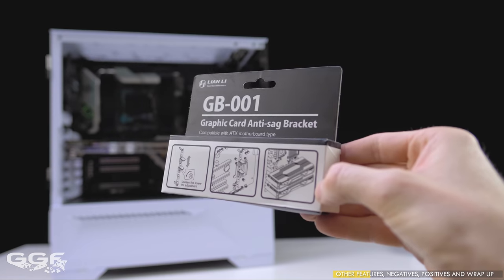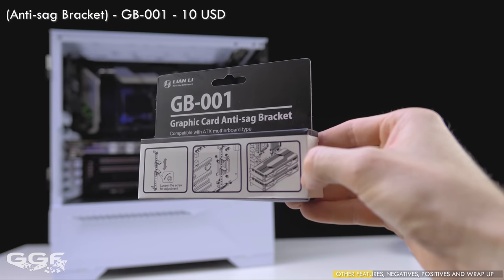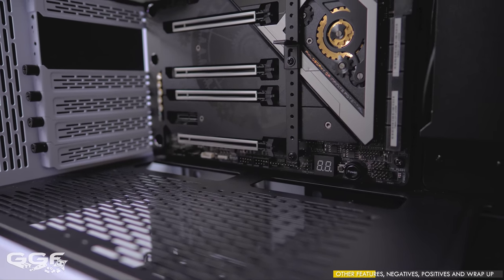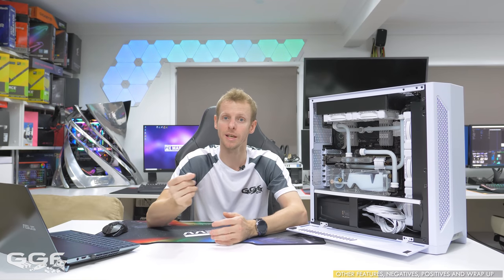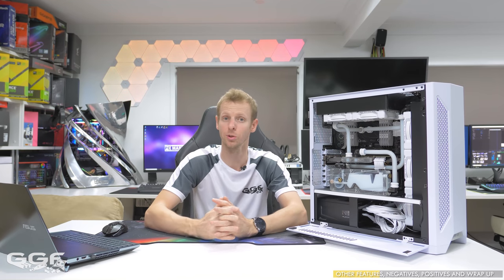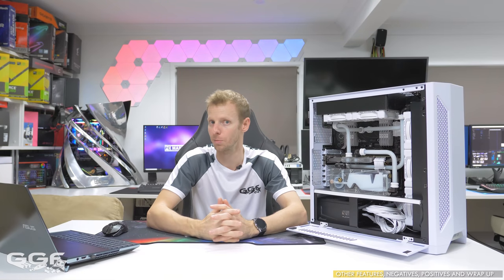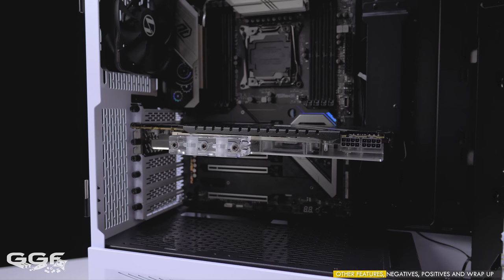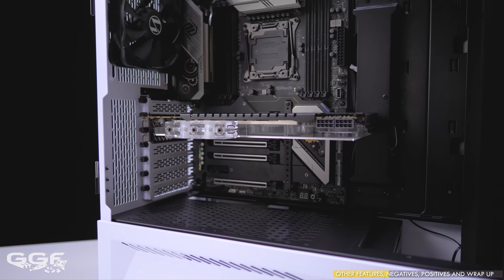The anti-sag bracket is about $10 US. I've used these in a lot of builds and find them probably the best anti-sag brackets on the market. They're really low-profile, easy to install, and hidden out of the way. They simply go between two motherboard standoffs — the center one and the bottom center one. Lian Li includes two sets of standoffs for each thread size: M3 for SSDs and UNC 6-32 for hard drives. A right-angle bar slides between the standoffs and can be adjusted up and down depending on your GPU. The bracket supports two video cards. Once installed, even my saggiest GPU was 100% perfectly flat with zero sag.